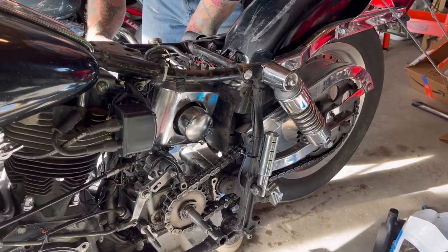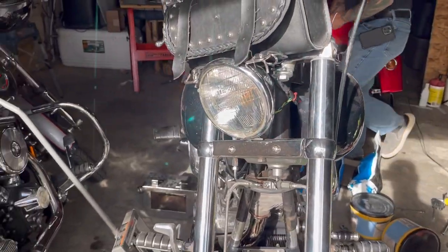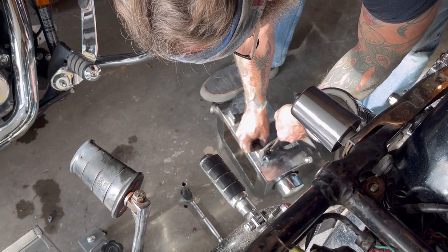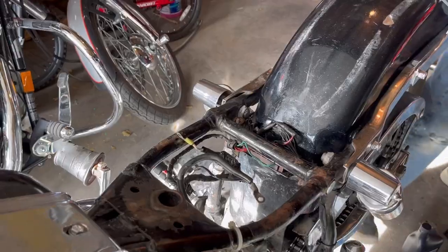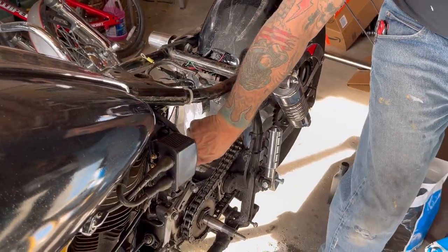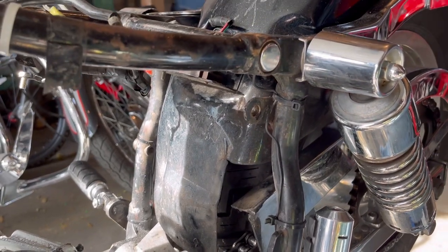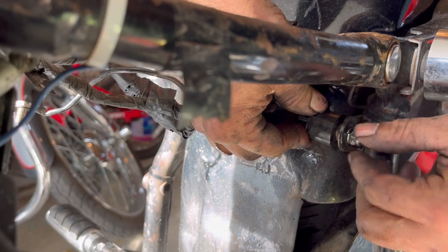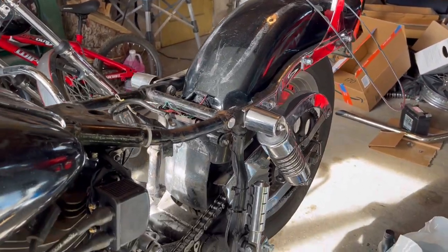That one's stripped out — coming back out. What I'm going to have to do is put this rubber bumper on the frame first. If you watched when I put the first bumper in the frame up by the clutch cable, it actually threaded into here. Here's the same bracket but the threads are no more, so we're just going to have to back it with a nut. Now let's see if that oil bag will feed in the way it's supposed to.